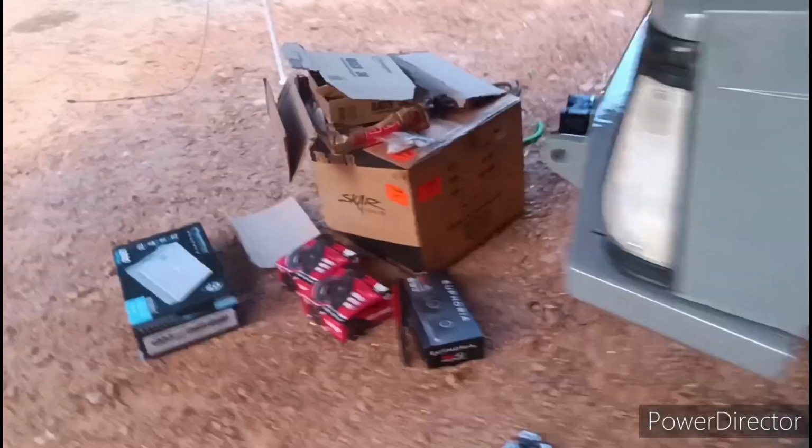All right, YouTube. I picked up most of everything, and I got everything buttoned up. I got the battery hooked up temporarily without the new ends or terminals so I could roll up the windows and everything before it started raining. Since the belt is tightened and all the wires are hooked up except for one, the alternator won't come on yet because I haven't run a wire to the fuse box. I have to run the switch wire to the fuse box, and it should be done.